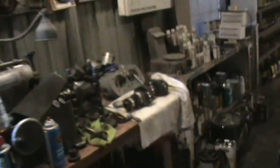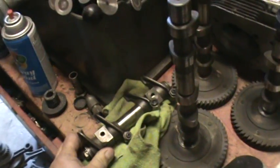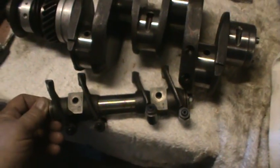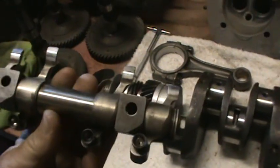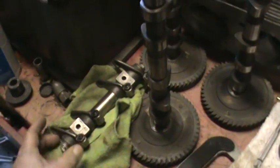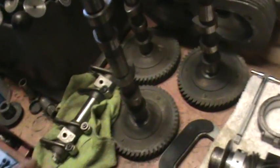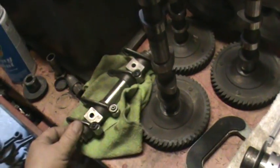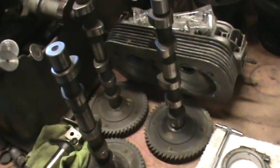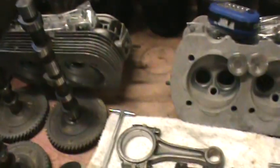Of course you have the chance of wiping the cam out and all that stuff. What I was thinking about on this motor — since I haven't done this with you guys yet — is take a set of high lifts and use those instead of the camshaft. These are a set of 1.5 Berg Rockers, really sweet. You don't have to have Berg Rockers — you can buy them from Bug Pack or CB Performance. The Berg Rockers are a thousand dollars for a good used set, and you can get a set of CB or Scats for like $260. You can usually pick up about 40 points on the cam lift. So if you have a 400 lift or a 380 lift cam, you can add 40 thousandths of an inch of lift.